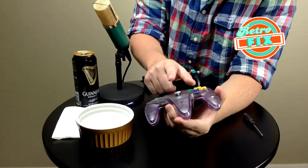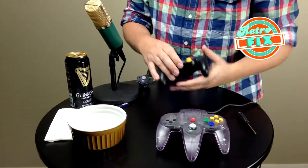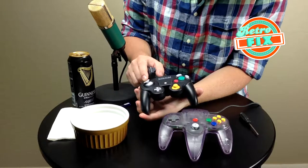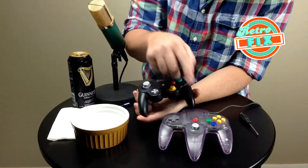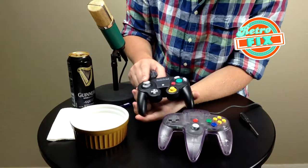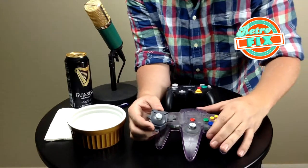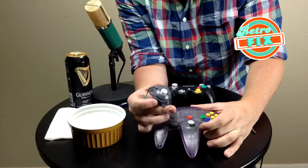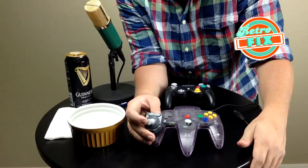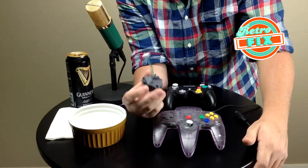So what we're going to do is replace this piece. When I said I was going to get it to work like a GameCube controller, what I mean is there's actually a pretty big market for aftermarket replacements now. On the GameCube controller it has this eight-way octagon thumb stick. The N64 still has that bowling pin thumb stick — this replacement is more of a traditional thumb stick that you're used to nowadays. I got this replacement thumb stick for the N64 made in Taiwan. It's not something you can just run down to your local Radio Shack. What's different about it is that it's not a bowling pin anymore — it's actually a real thumb stick. You're going to be able to put this in your N64 controller, it'll last way longer and wear a lot less.